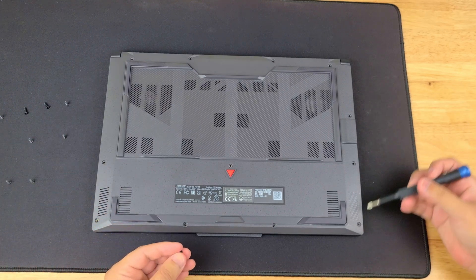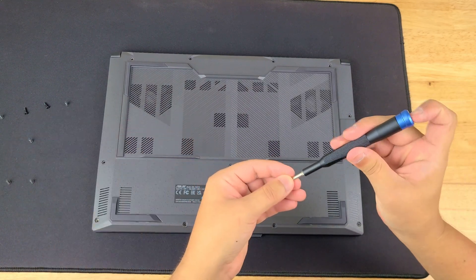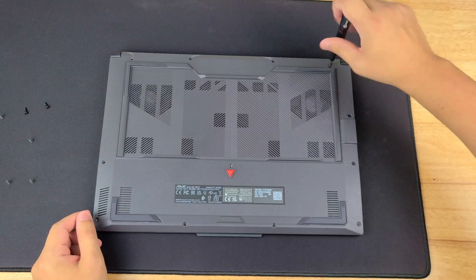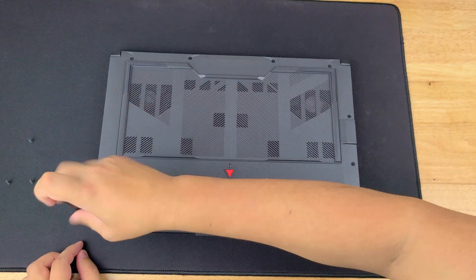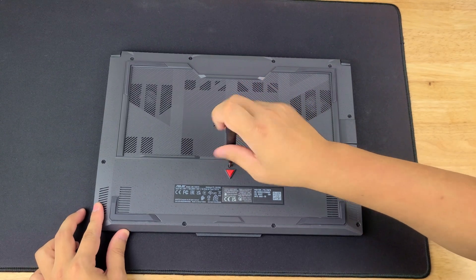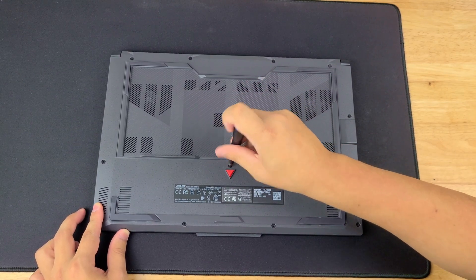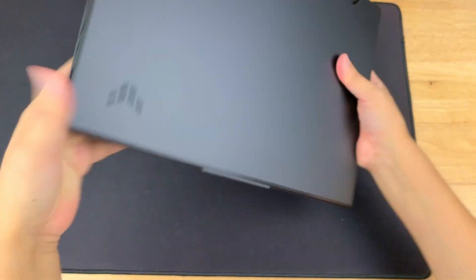Now that we've done that, you can set it back down. The first thing I like to do is screw the bottom right screw back in all the way, which gets rid of the gap. That's really nice because it creates a gap for you so you don't have to keep stabbing your computer. We go backwards from there. The middle screw is a little longer than all the other ones, so don't mistake that for any other ones. And we're good. That is how you take apart your Asus TUF Dash F15 and upgrade the RAM and the NVMe in it.